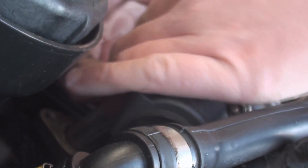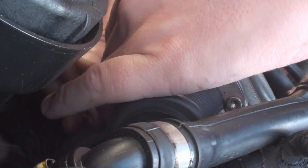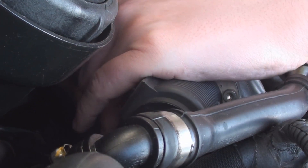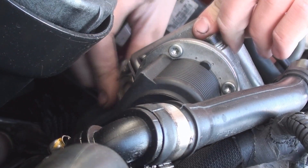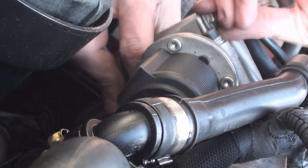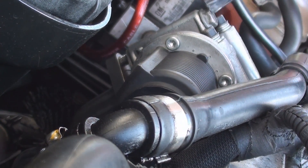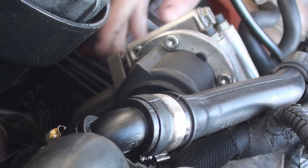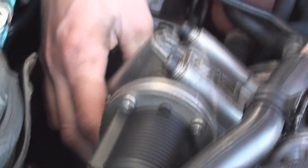In doing this process though, 9 times out of 10 you'll get an engine management light coming up on your dashboard, which clearly states that there isn't enough gas going around the EGR system. You can either ignore it, or you can take it to a remapper and they can delete the system out of the car so you'd never get that light come on again for an EGR fault. Or you could get a blanking plate which has an 8 or 9mm hole drilled in it — this still allows a little bit of exhaust gases to pass through, which will stop the light coming on, but you will still build up sludge in the inlet manifold, although it will take a lot longer.